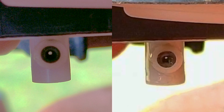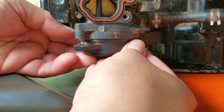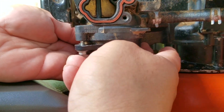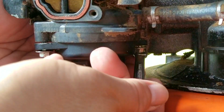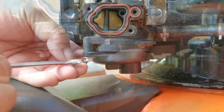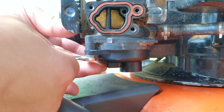Now that the jet is cleared, it's time to put the bowl back on. The reason I decided not to take the carb off the engine is pretty simple. Taking off the carb requires you to disconnect the fuel line, which on this engine is not easy. The second reason is that doing it this way means you don't have to worry about any of the linkages on top of the carb, like the auto choke or the governor linkage — meaning you don't have to worry about breaking them or installing them incorrectly. The last reason is that I'm pretty lazy, and if I can get away with getting the job done without going through the whole routine, I'm all for it. This is just a lawnmower and not a race car.